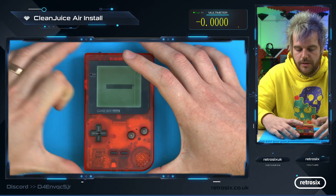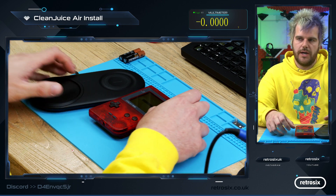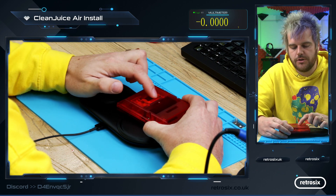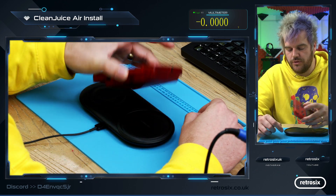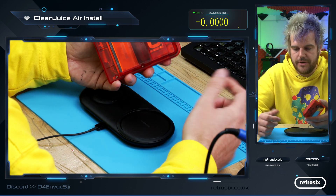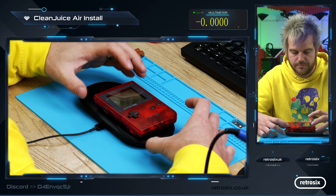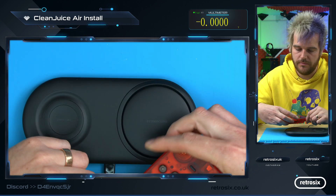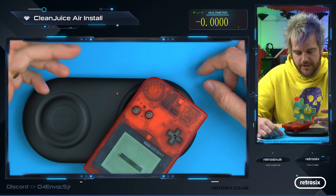When the battery is low and you want to charge, simply grab a wireless charger — most will do. What you're looking for is to place the coil central to your charger coil, as they only work when aligned. Being central is very important — the more central you are, the more efficient it is. If you're off-center, things get hotter and less efficient and it takes longer. Place it down centrally, and you can see a red light come on the charger indicating it's charging.